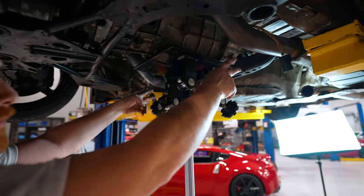and then the rod has a little bit of knurling. That way you can just grab it with your fingers and twist it with this clevis sitting still, and you can thread it to expand it or collapse it. If you have too much throw, you can make it shorter. In this case, we're gonna make it a little bit longer. That way the engagement isn't right off the floor. So we'll just make the throw a little bit longer, and that'll give Dave that extra engagement he needs so it's not releasing right off the floor. So yeah, let's go do that underneath the dash.